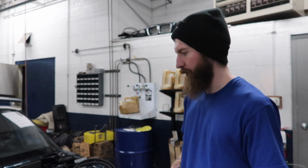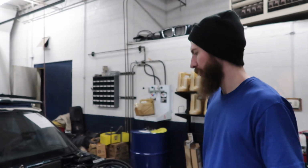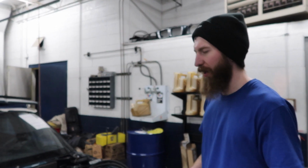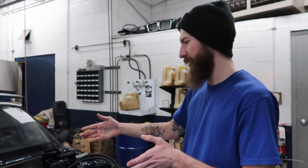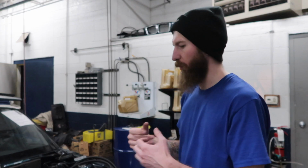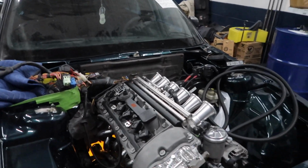I'm gonna chop that off because on these motors, you want the merge point to be as far back as possible for the most torque. Yeah. I didn't know that either. I have a Billy Boat catback that's just the resonators. I don't have the rest of it. But then it's welded to a little extender, a Y pipe, and then a MagnaFlow dual walled tip muffler. So it's kind of all custom. It's not like the E36 when you put an S54 in it. You can use mostly E36 stuff. No. Yeah. A little more work than that.